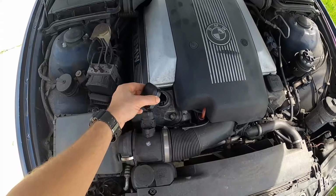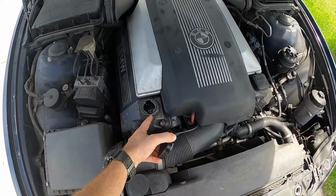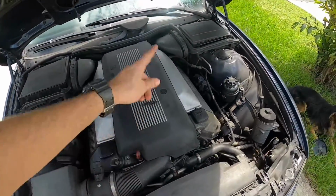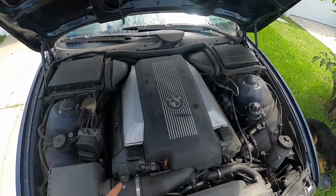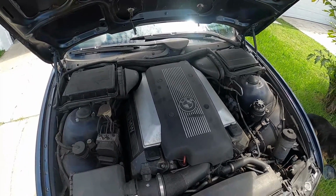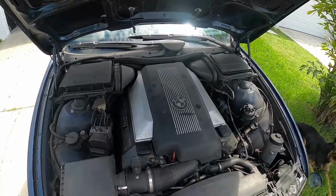So I'm not sure what happened, but definitely when I try to turn the motor over, this timing chain does not move. And so for that reason, we have definitely got some bent valves here, bent valves over here, and that is why this car won't run even if I replace the timing chain. So probably going to require a little bit of work to get this motor going, but I think if we can salvage it, we can get it in the Titan Silver car, no problem.